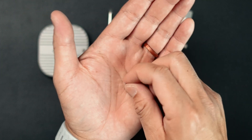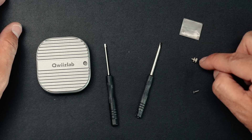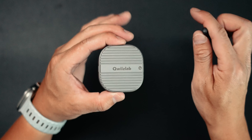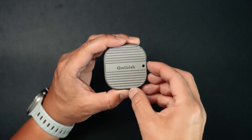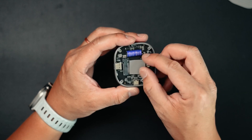We're going to use this to keep the enclosure closed. Something nice to keep in mind is that these three — this silicone pad, this flathead screw, and this star screw — are all actually extra pieces. There are pieces already inside. So the first thing we're going to do is remove this star screw right from the top. Now we can open up the enclosure, and inside is the silicone heat pad and also this flathead screw that'll keep our NVMe into place.